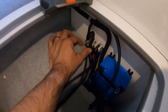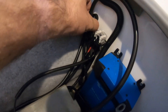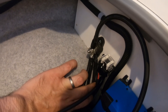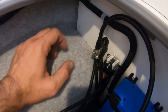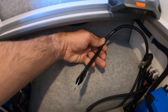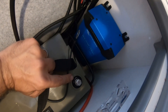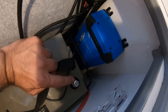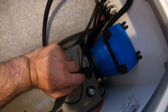It turns out the only place where all the wires are going to meet together was over here on this terminal post, well attached to the cabinet. All of the wires come together — three wires: one from the charger, one which is the earth bond to the chassis, and one that returns back from all the other electrics in the van. I've got a 16mm return cable which is going to go onto the P-minus on the shunt, and then another wire that comes back to the negative point on the battery. So onto the home stretch as far as wiring — all I've got to do is get the shunt mounted, get these cables attached to it, and then we can start wiring in the control module.